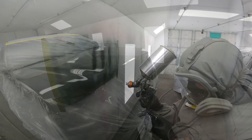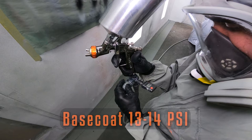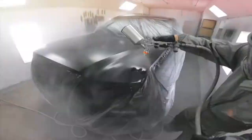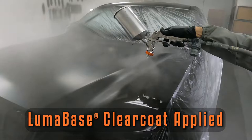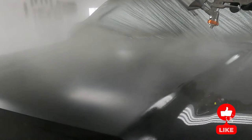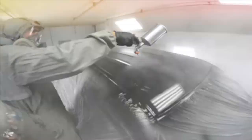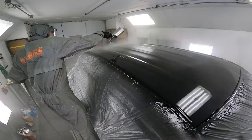I'm going to shoot some basecoat out of this thing now. For a solid color, I'll go ahead and kick it down to about 13-14 PSI. At the end of the day, if you only want to own one gun and you need it to perform on a professional level with pretty much anything you put in the cup, then this is a great choice — with the caveat that depending on your skill level, there's probably going to be a slight learning curve. Coming in at around $450, this gun is incredibly well-priced, and you can even find off-brand aluminum one-liter cups on Amazon for like 20 bucks. Are there guns that give you a more effortless application? Yes. Are there faster guns? Yes. But overall, I'd say it's a five out of five for value for your money, three out of five for ease of use, and a four out of five for finishing capabilities.